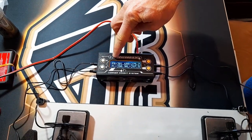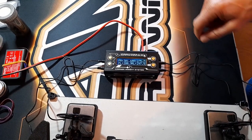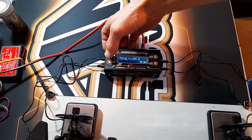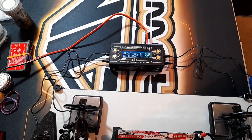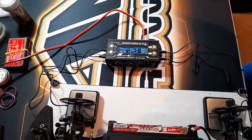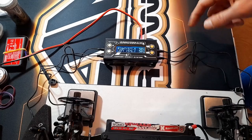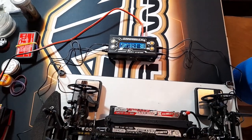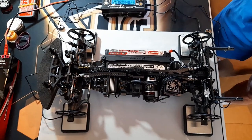Front right: 301. Front left: 280. Rear right: 275. Left rear: 297. So it's a little bit out that way. Not worried about the total weight. Front to rear: 50/50 — 582 versus 573 — so I'm nine grams heavier on the front, but it's still reading 50/50. Right to left: 577 versus 578 — 50/50 absolutely spot on, about a gram different left to right. That's pretty good. I've got to be happy with all that — 50/50 both ways.